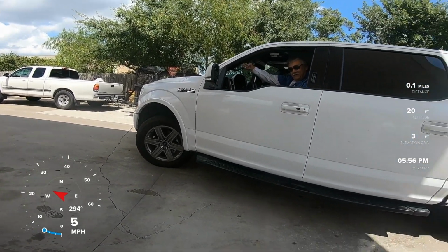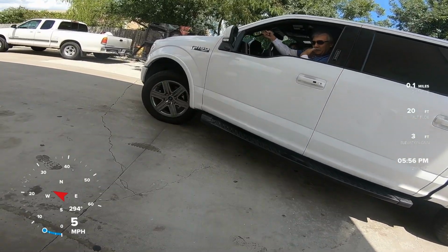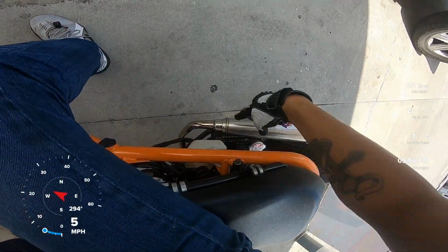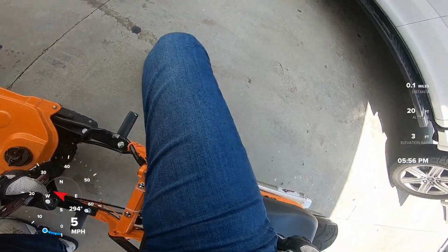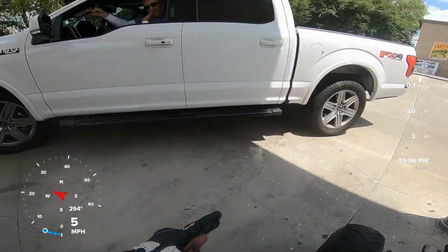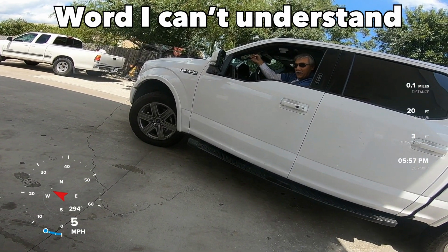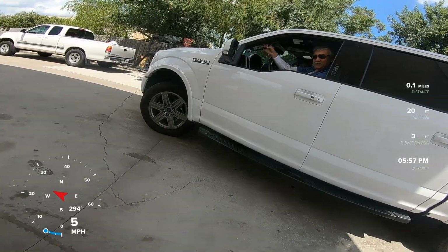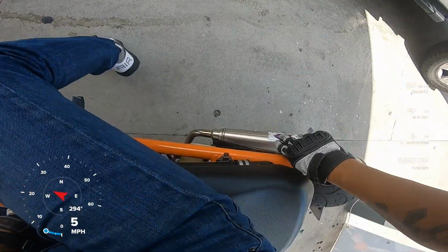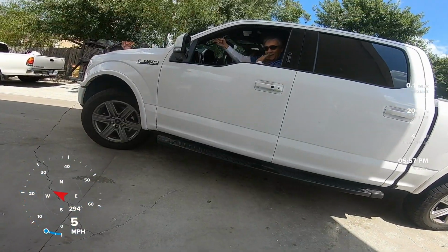Man, that's pretty trippy. It's a Honda Ruckus. Yeah, Honda Ruckus, and it doesn't look like this. I've done a lot of stuff. Like, the motor is supposed to sit right here, so the tire's underneath your seat, but then I offset the motor so that I could put a bigger wheel. Where the motor mounts, which is here, is now back here, hanging off of a support beam right here.